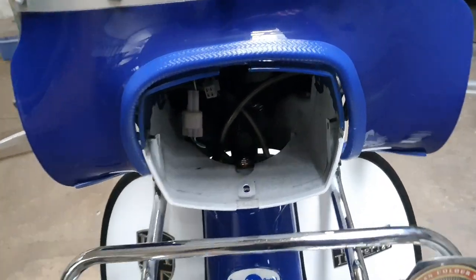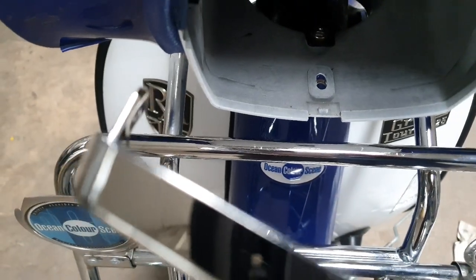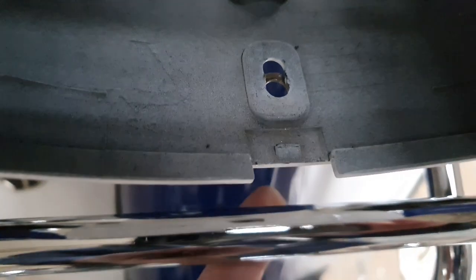Removing the headlight unit is straightforward. You've got a little silver trim that literally just slides off — it's got four little clips, one on each side and one top and bottom. The top and bottom ones just push in, and the two on the side are held in by screws through those tiny holes. Then on the bottom you've got a 10 millimeter bolt that holds it in, undone from underneath. Easy enough — slide the decorative trim off, slide the unit out, and just detach it at the terminal block.